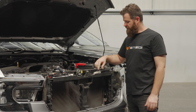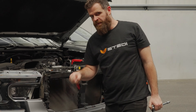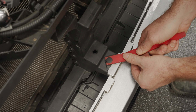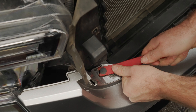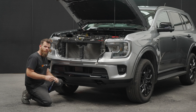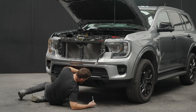There's a big plug on the top — that's actually the whole loom for the bumper, so we want to disconnect that. We've got two 10mm head bolts and three little plastic clips. A trim tool really helps here, but a flat head screwdriver will also work. There are a couple more bolts underneath and some in the wheel arches — a little bit tricky — so let's jump under and get these bottom ones out.